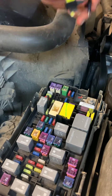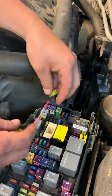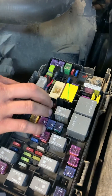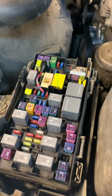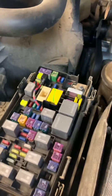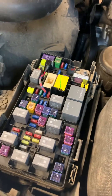All you do is make your harness — it's about $12 in parts — then plug it in here and go around and plug into the fuel pump relay fuse. And now it works perfectly. The dealer wanted a thousand bucks for this box, and there are 150 of them on back order currently. It's September 2021, so thank you, COVID.